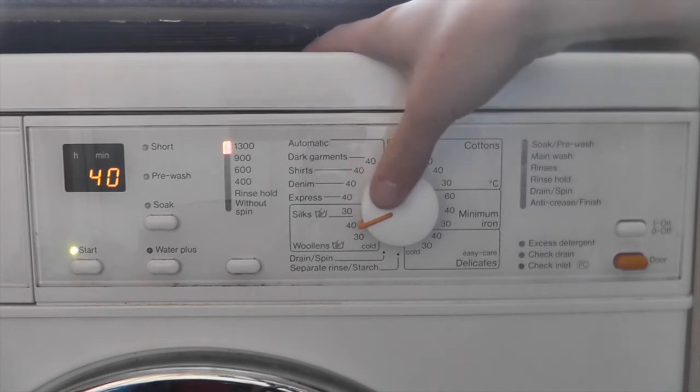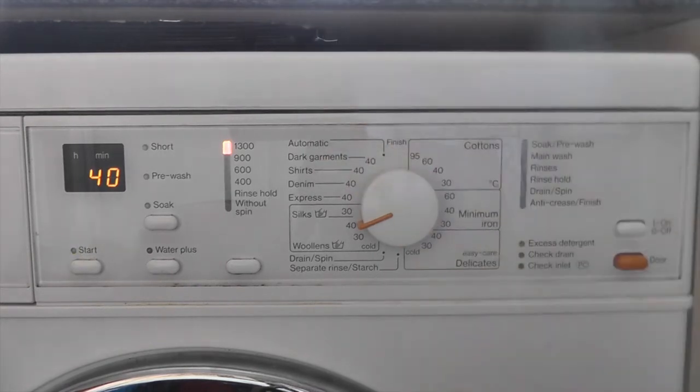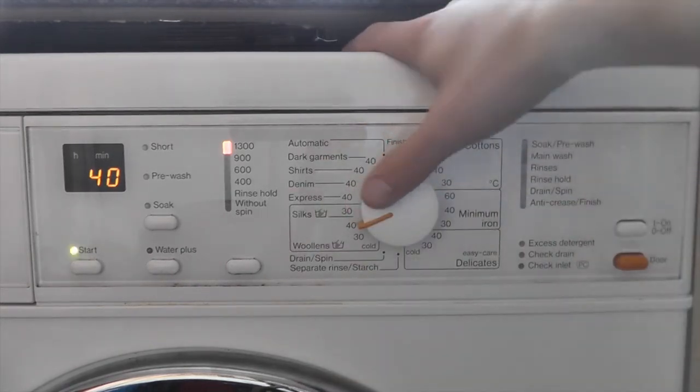That used to be R1. The reason we stopped is because it had very poor rinse and washing performance. It wouldn't actually heat to 40. I think it would get to about 20. And it only did one burst on the intermediate spin, so it meant it would wash suds back into the rinse, and it would only do half a drum action, half a turn.